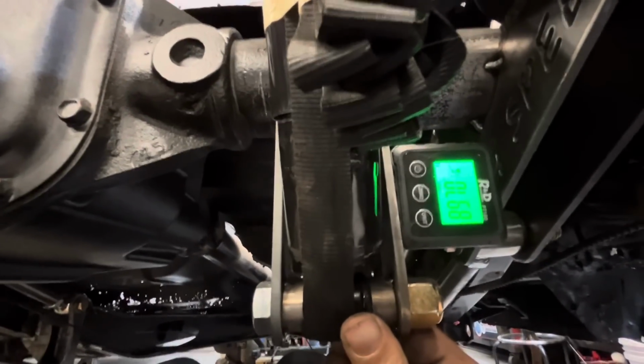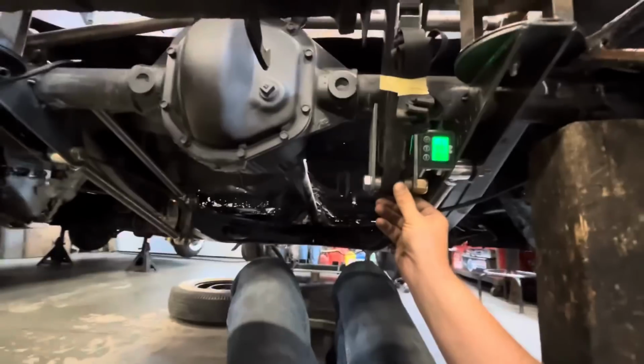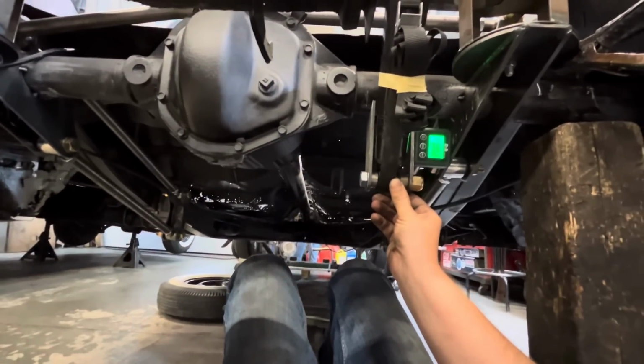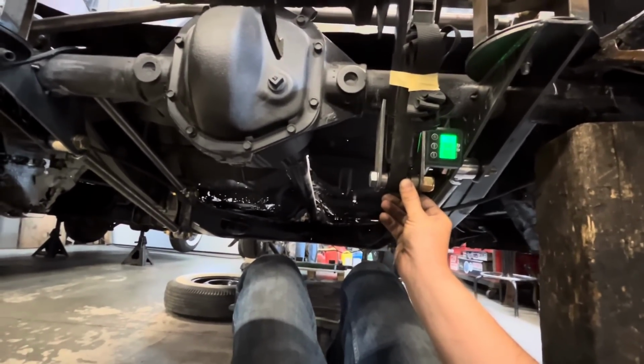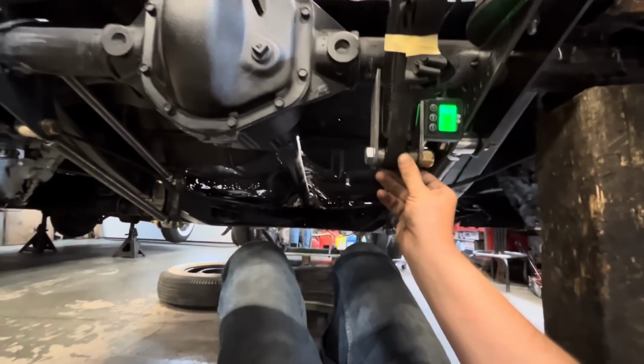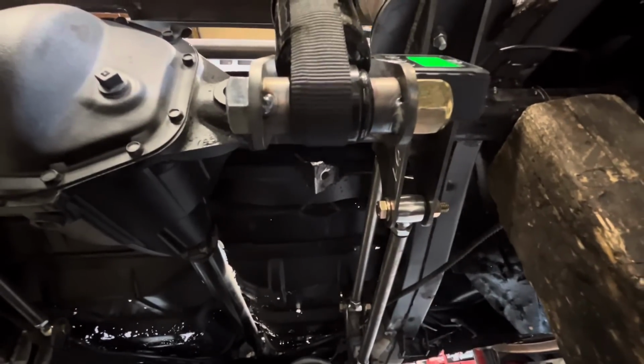There we go. What's wrong with that? We got our little spacers in there to give us clearance through here. We fit on the axle really nice. We're not hanging down. I mean, it's hanging down a little bit lower than the center of the rear end, but not a ridiculous amount. Not enough that I think it's an issue. And we are 89.9. So let's clean some paint off here and then we can tack that.